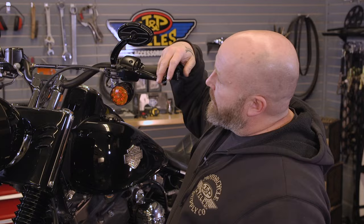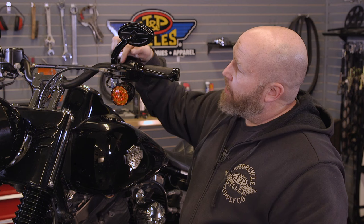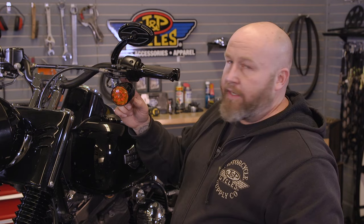Okay, so we have a ton of slack in our cable now. This is gonna let us pull this loose out of this housing. But now we have to come around back here, pop the little retaining clip off of the pin for our lever, so the whole thing will slide out. Snap ring pliers is what you're gonna need. If you don't have a set of snap ring pliers, you can do it with a small screwdriver. Just try not to booger up your clip there.